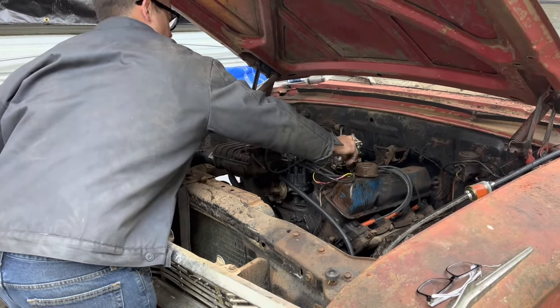So we just reused everything, the old gasket, the old filter, because I couldn't get one from the parts store in time. Okay, let's put some fresh Type F down in this thing and see if that helps at all. I don't know what else to do if it doesn't, because if it doesn't work with this, something in that transmission smoked, because it's obviously moving the shift lever correctly. We know the filter's clean now, the fluid's good.